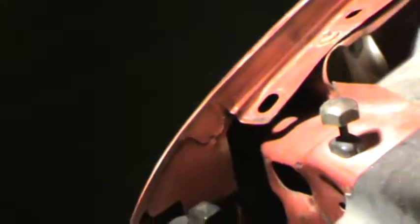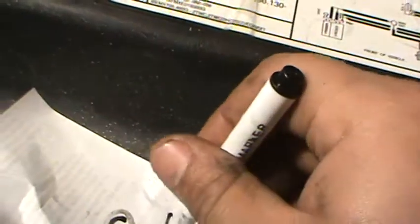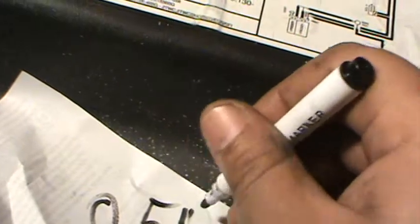I think it was like TR55. TR55. Oh, yes, yeah. They're going to be gapped at 0.054. So 0.54? All right. 0.054, yes, sir. All right. Thank you for your time. Not a problem, sir. You have a good day. You too. Thank you. Bye-bye.